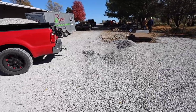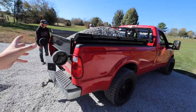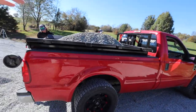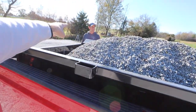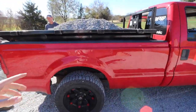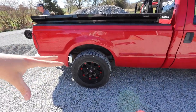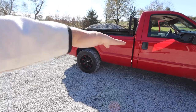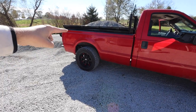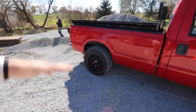So this is our little testing area. What we did was bolt in the main mechanism onto the truck, then put the dump bed in and loaded it with three scoops of gravel — probably about a ton and a half, so 3,000 to 3,500 pounds. Our airbags are on setting five right now and the truck is perfectly level, so the airlift system is working really, really well. We can even take the remote and go up and down however high we want.